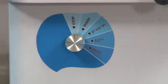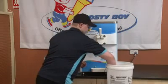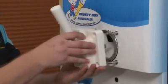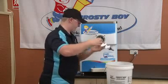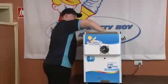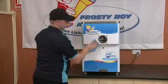Turn the machine off and ensure to also turn off the main power. Unscrew the bolts of the dispense head and carefully remove all parts from the machine and gently place into the bucket. With a cloth lightly dipped in sanitising solution, wipe the machine all over, starting with the hopper and the barrel, then the front and the side panels.